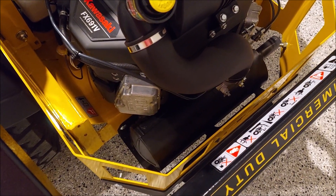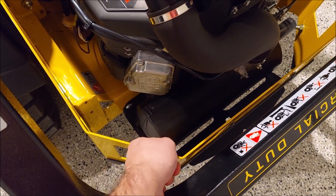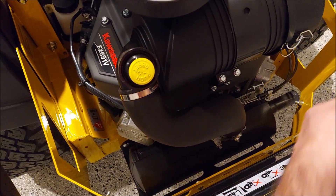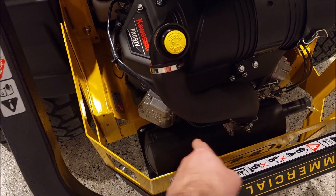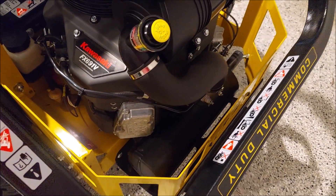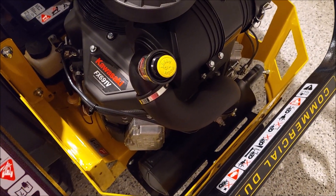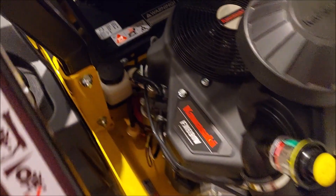There's a muffler and a carburetor, and there's only half a heat shield built into the top of the muffler. I wish they had a full metal heat shield to separate the radiant heat — so it would blow off the sides instead of soaking into the muffler. That muffler stays hot all the time, and that's going to be a great heater for the carb. Some guys were having problems starting these things after they're warm — I wonder if heat soak is an issue there.